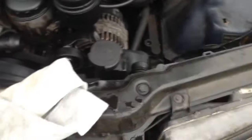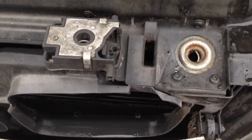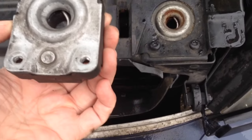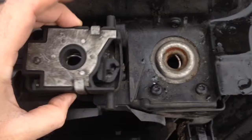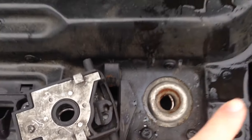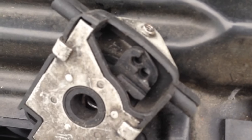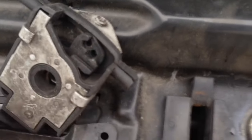We've got a few parts dug out here to better show you what's going on. With these hood latches, we have one taken out of the car — this is actually an E39 hood latch, and I think they're the same or very close to the same. On the bottom of the hood latch we have two little holes: one hole for the cable going this way, and one hole for the cable going to the passenger side latch. You can see on this one it's actually broken — it's sheared off right there. That's a real common problem and it'll make the hood not open.